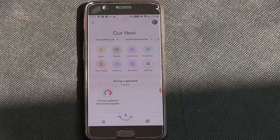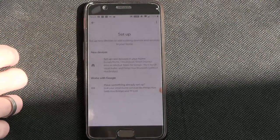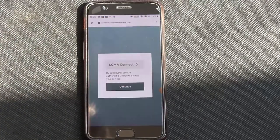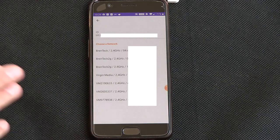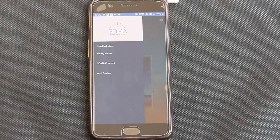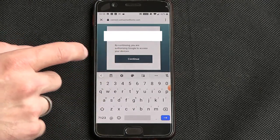We'll now try adding our device to Google Home Assistant. Come to the Home app, click Add, set up a new device, Works with Google, then search for Soma Smart Home. You'll need your Soma Connect ID, which is the MAC address of the device. Find it by taking your phone, opening Soma Connect, and placing it next to the hub — it will detect it and show you that information. You then type it into the Google Home app. Note that the Wi-Fi MAC address is the ID, so you must connect via Wi-Fi, not via the Ethernet cable.